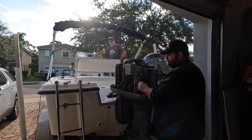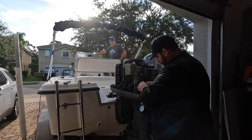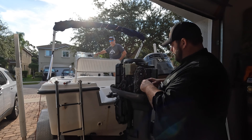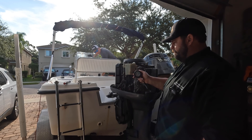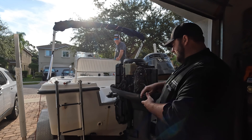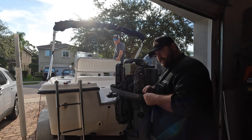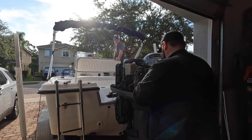Now going to the next cylinder, testing one by one. Screw it in tight, make sure you've got a good seal. Bill, go ahead. That one's right at about 100. So that cylinder still has good compression. I'm going to mark it as 100. You've got to realize this engine probably has thousands of hours on it — that's amazing compression.